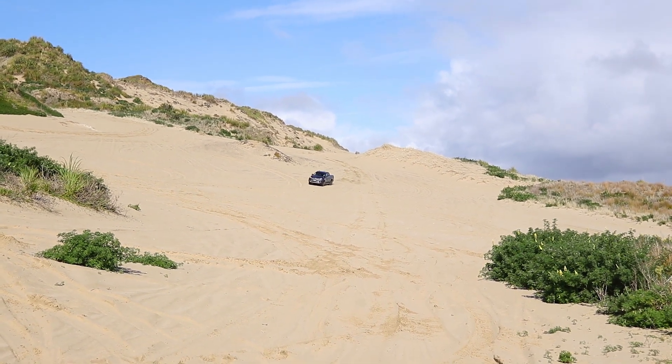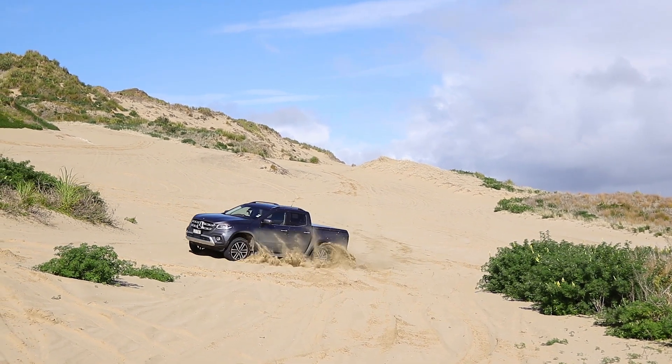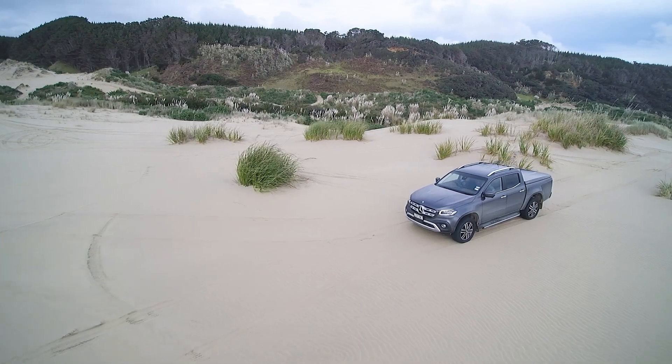We discovered that the X-Class is not king of the dunes. We tried our hearts out but we didn't make it up the big hill — we put that down mostly to the tyre size. Because of these big 18 or 19-inch low-profile rims, we only let them down to 15 psi. It's still so much fun though, it's still handling this pretty well. Stock standard it does well, but if we added some bigger tyres and maybe a lift, we'd get that little bit more we'd like for overlanding. In stock form there's going to be limitations to any vehicle — you have to figure out what works for you and tailor the accessories to what you want to do with it.